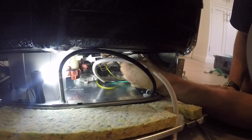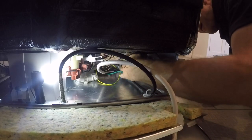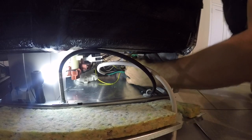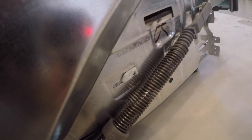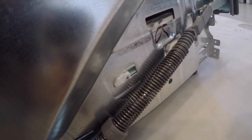Now at the back of the dishwasher, we're going to set the board in place on the side wall and snap it into place. Moving the camera around so you can see the bracket and where it snaps in - right there above the spring - and then it just slides and snaps into place, and that's what holds the board in place.